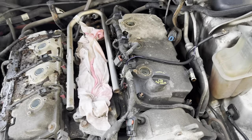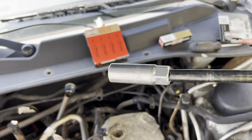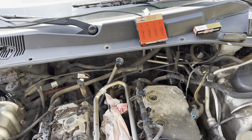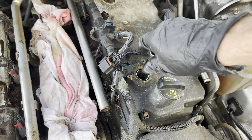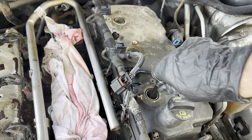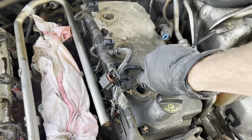The spark plugs are bad, so I've got new ones. I also noticed the valve covers are leaking a bit. Once the new spark plugs are in, we'll start putting it back together. I'm going to use an extension and spark plug socket and install each spark plug by hand first, then tighten. Be careful not to damage anything or drop them, because they crack easily — a cracked plug will cause a misfire. After tightening, look in the hole to make sure the spark plug still looks good. Don't flatten the tip, as that will mess up the gap.